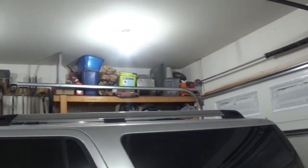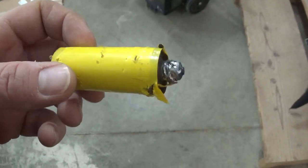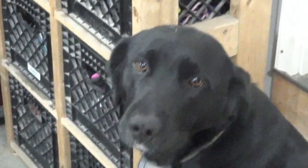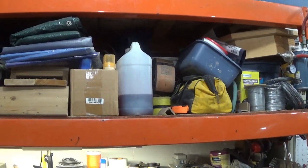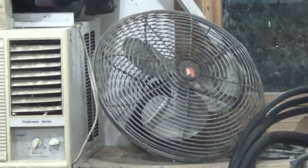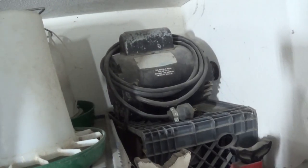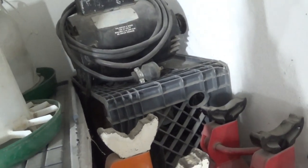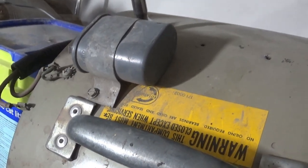It's a little bit bigger than the one that was on this thing. Before we go that route, I think there's another one here somewhere. I'm going to go digging. I came back to inspect the start capacitor to see what it was rated for, and you can see somebody got to it — did you chew on this? I struck out up here. I know I had an old refrigerant pump off of a window unit, was going to make a vacuum pump out of it, but apparently I threw it out. There's a ceiling fan — crazy motor, currently wired for 240, can also be three phase, I don't want to mess with that. I'm going to yank the one right here off my furnace fan that I just use in the summer to circulate air. The reason I'm taking this one over any of the others is because it's by far the easiest one to get off.